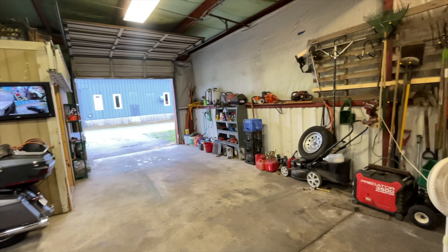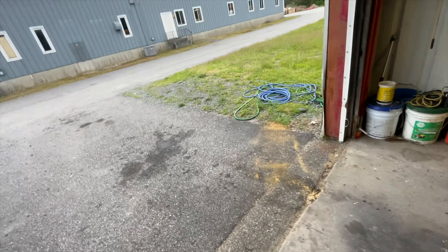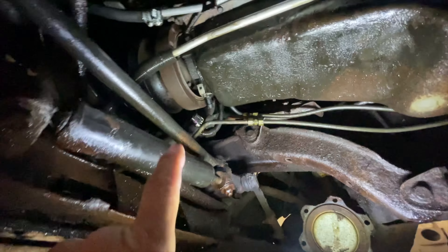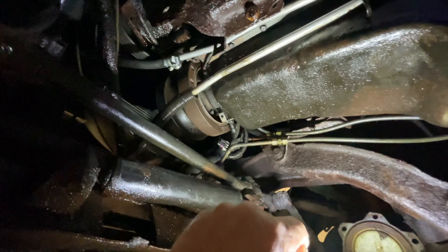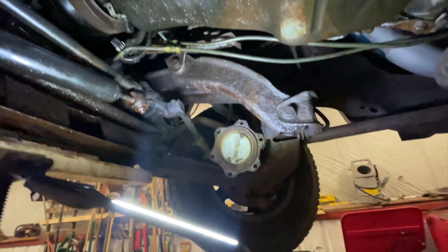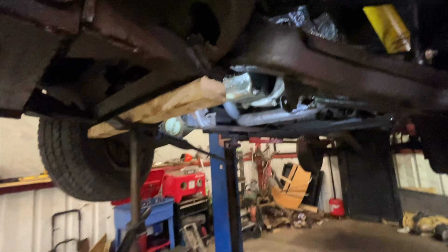Of course the lawnmower is coming out right when you start. So back to where we were. I had my oil cooler line separate at the pinch fitting. It was a faulty line - it seems to be a big problem. I put up a video earlier in regards to everybody else having the same issue, but it dumped out all the oil and the motor locked up on me. I couldn't get it to turn over with the starter.